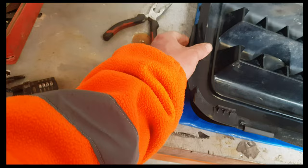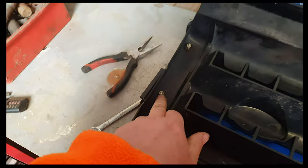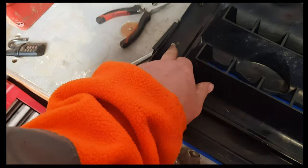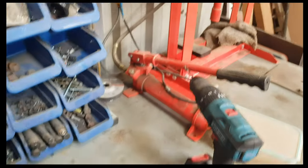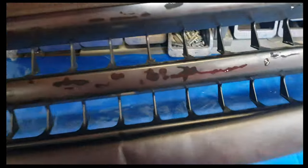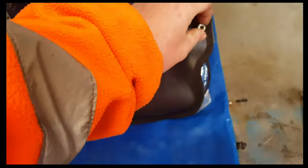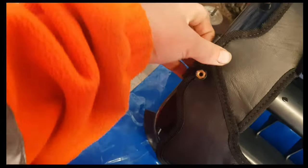Okay, so apart from it not fitting around the sides and there, it's actually okay. Fits nice in the top and the bottom. You see like these clips just grab it. Now I've popped these studs out for the headlamp guards just on those two sides. Drilled a 5mm hole through the leather. Actually it's that way, isn't it? There you go, that's better, and it actually fits all right. So these studs are holding this on anyway, so you don't really need to try and wrap it round.